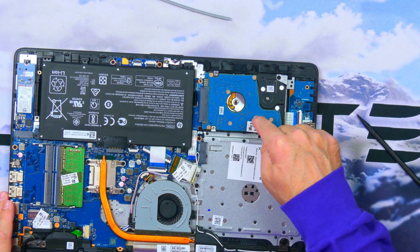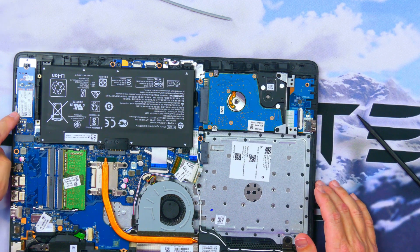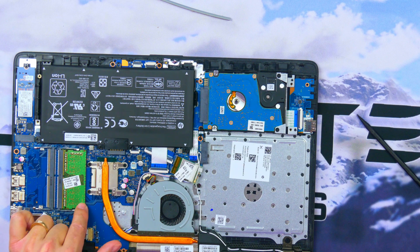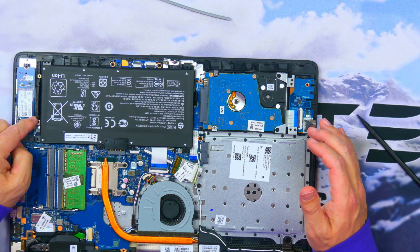You can see there is, in fact, a spinning hard drive in here. And this thing that looks like an M.2 SSD is actually Intel Optane memory. Optane memory is not exactly the same as DDR4 memory — we have a single 4GB module of that here. Optane memory is closer to solid-state memory in that it figures out what programs and tasks you use most often, then stores those programs so they can be loaded from the faster memory module rather than the much slower hard drive. But just replacing the hard drive with a much faster SSD really negates the need for Optane memory.